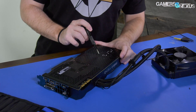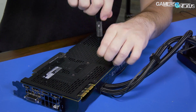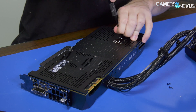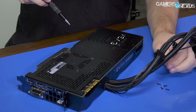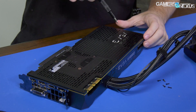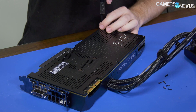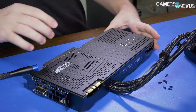Same process as with all the others, except we've got one screw pre-removed - actually two or three pre-removed because there are problems. So we're going to start with taking out the backplate, and it's in two pieces. It's die cast, separated at the center primarily because from a die casting standpoint it's just easier to manufacture that way. They've also told us that there might be some thermal benefit by having that divider down there, but I think more so it was just easier to make this way - the thermal benefit may have just been a convenient justification.